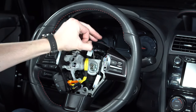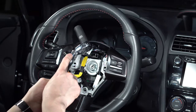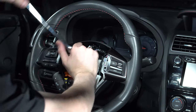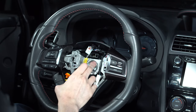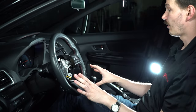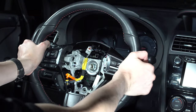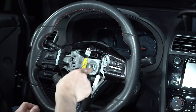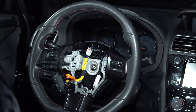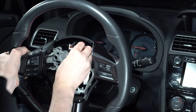We have one main connector — disconnect that — and then we have our 17 millimeter nut. You may need an extension or an angled ratchet to get this without damaging your wheel. Start to undo the nut but don't take it off all the way. At this point it's very important to not turn the steering wheel — leave it centered — so you can get it back on center when you're ready to reassemble. Take the wheel and rock it side to side, gradually pulling it off the hub. That nut is there to protect you from hitting yourself in the face. Once it's off, undo the nut, then carefully remove the wheel, threading the airbag connectors through to not damage the clock spring.